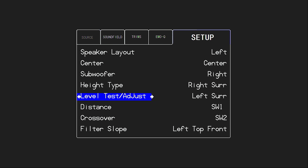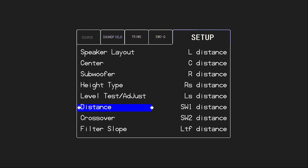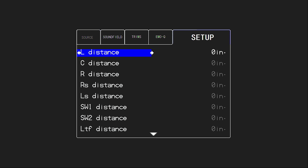After going through all channels in the Level Test/Adjust to ensure speakers are connected appropriately, a couple of other things to do in your basic speaker configuration are setting your distances and crossover points. Distances are pretty self-explanatory — you manually input how far away each speaker is from the main listening position. Sit in your main listening position and have someone help you run a tape measure out to each of your channels. I usually recommend pointing it at the tweeter or mid-range for your measurement. By default distances are set in inches, and scrolling up will jump to feet. You can change units to metric in the Options portion of the setup menu.